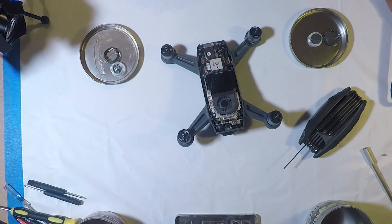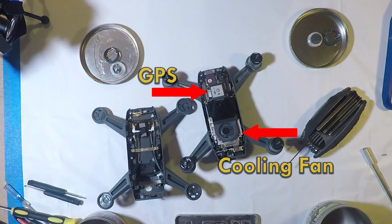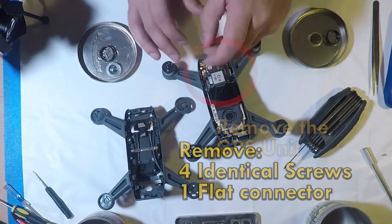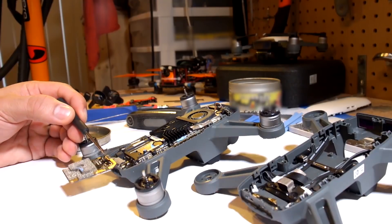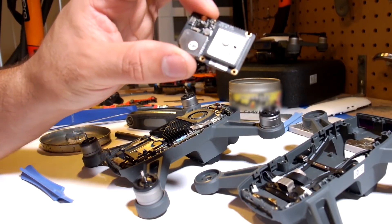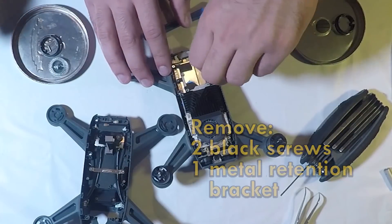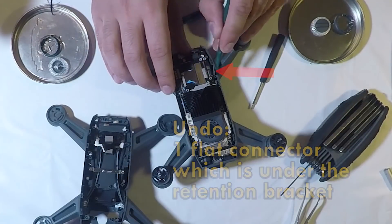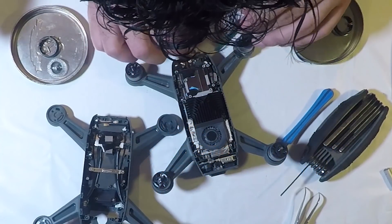In the back we have the GPS unit, a cooling fan, and presumably a processor in that area. Remove the GPS unit — there are four screws and one flat connector for this. Now remove the metal clip to the left of the GPS board; this requires two screws. Underneath the clip is the main power connector. Behind the GPS area are two antennas — remove the foam foil and the two antenna connectors.